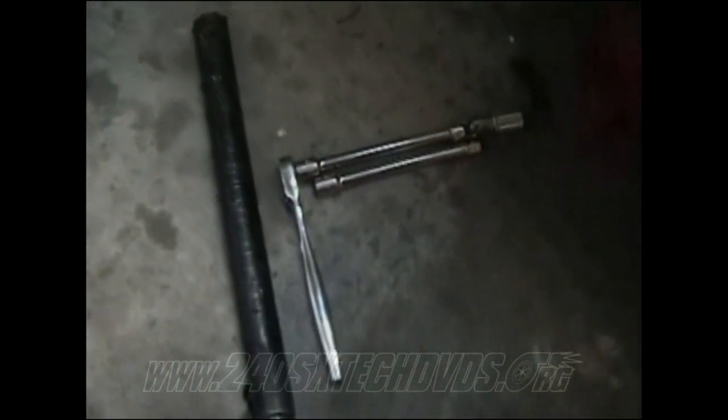I had no problems. Okay, on the driver's side of your transmission, you have your crank angle sensor up top there. You need to remove that. It's got a plate on top up there. It needs to be removed first, and then it has a little screw that screws to the bell housing, actually. It's a 10 millimeter screw. You need to remove that, which will remove the plate, and then you can slide the crank angle sensor up and out. Don't damage it, it's very breakable and easy to break.